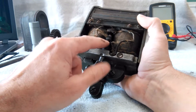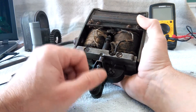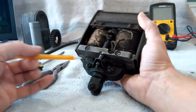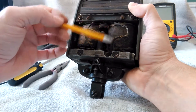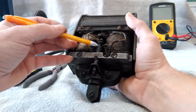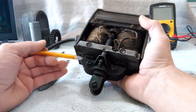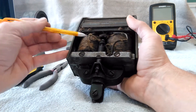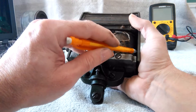When you break your contact points, you're causing the magnetic field to collapse onto those iron cores. Right down in there are your iron cores; those run up here through your coils on both sides and go back to your magnets. When you break this contact point, the magnetic field collapses back onto these iron cores, and basically what happens after that is it surges back out and induces the secondary coils.